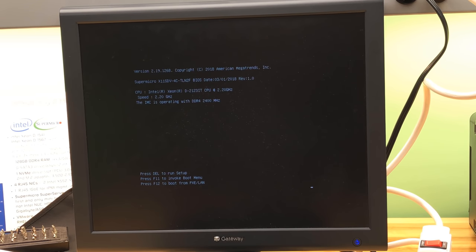Save changes and reset. It didn't hang on A9, so the BIOS would hang on A9 if the Optane wasn't working. Looks like the 900P is supported in this motherboard and just wasn't on the Xeon D-1500 — that's my current thought. Here we are watching the boot sequence. In 4K resolution, if you have a decent monitor and full screen this, you should be able to follow along. We have a more verbose boot this time without the Super Micro splash screen.